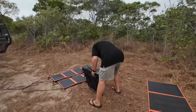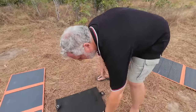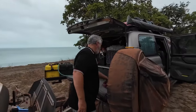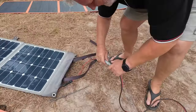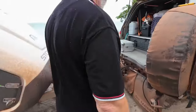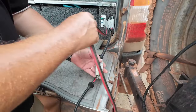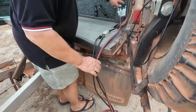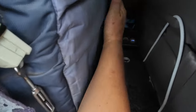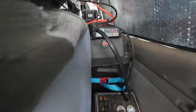We keep getting sun, we keep getting rain. This is an old eBay solar panel but it still works. I'll plug this solar cable from the back of the car and that will plug into there, all plugged in. So I've got those three panels all plugged into the back of the one input. I've got a double adapter into another double adapter so I can plug one, two and three - three solar panels feeding into the input. That input goes through to the RedArc BC DC, just sitting on top of my battery box, and that charges the battery in the back of the car.